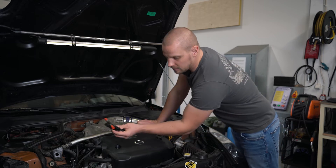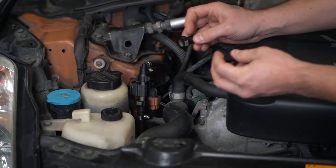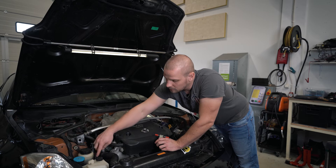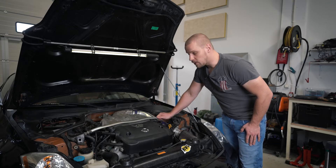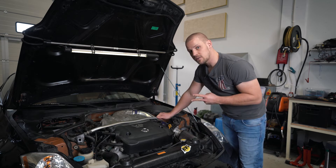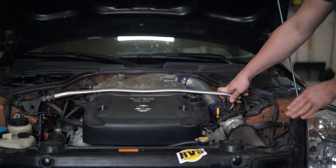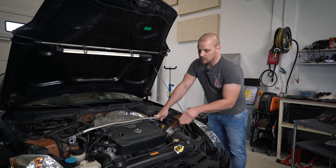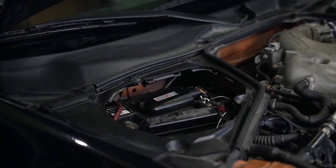For the ethanol sensor, it's located in this installation right here with two of the provided quick connectors and hose clamps. The wiring goes right here to the battery box. Additionally, with the eFlex Pro kit you have the option of two external analog sensor wires that can be connected to different components in the vehicle. In this build we have a mass air flow sensor and an external wideband O2 sensor installed and wired to the eFlex Pro control unit.